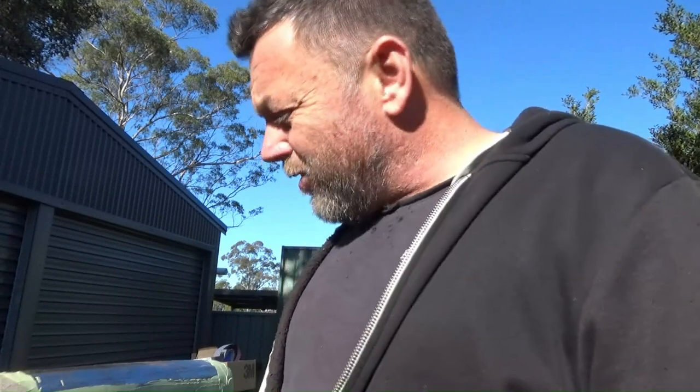Righto, the worst part about doing a car is, in my opinion, sanding bog. But I learnt from a few old mates that are in the trade. Heavy grit sandpaper, I'm using 40, and you just smash it off. Don't worry about the scratches. And then you use high fill to fill the scratches in. Then you sand the high fill, and it makes it a lot easier. You don't sand bog with like 400 or even 250. You've got to go 36, 40, something like that. But anyway, I'm just going to get into it, put some tunes on, and I'll speak to you later.